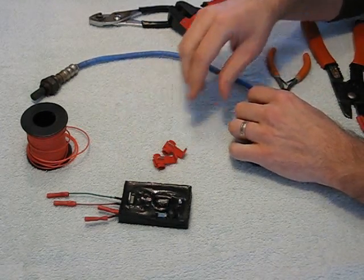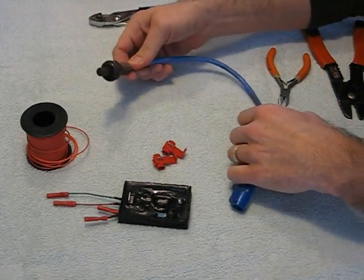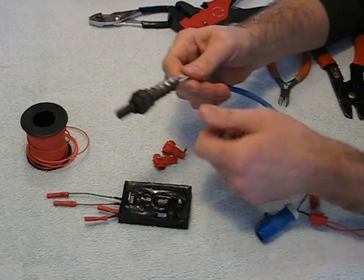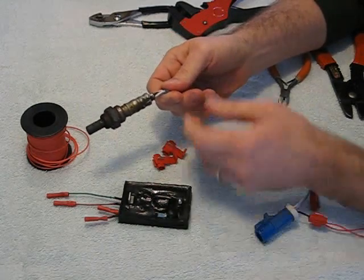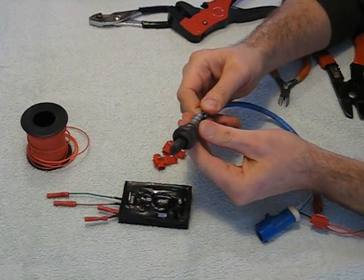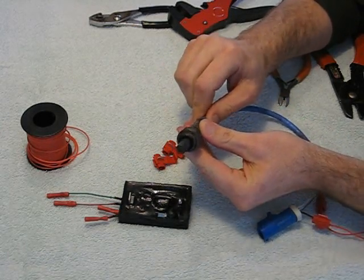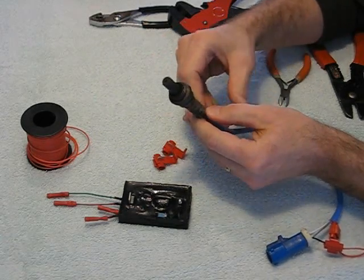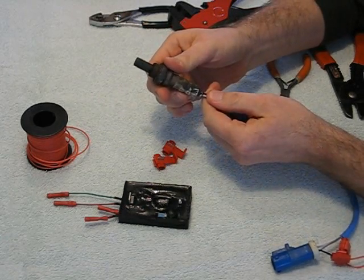The first thing you'll need to do is locate your oxygen sensor. This is an oxygen sensor — it's a four-wire heated oxygen sensor. This is common on most American vehicles. Some of them do have AFR sensors that look very similar to this, but an AFR sensor would have five or six wires coming out of it.